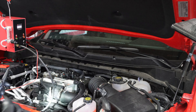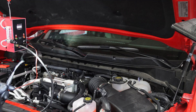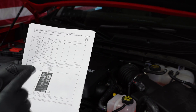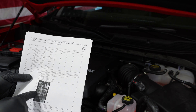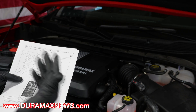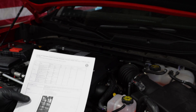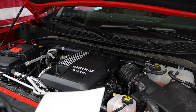We're going to be sticking this into the charge air cooler — it's going to fill it with smoke, and if we have a leak we're going to be able to see it. We've got an updated bulletin here that has now added the LZ0 to possible intake manifold issues. The LM2 had this concern as well: if there's an air leak, you do a smoke test. So we're going to do a smoke test on this LZ0 engine to show how that takes place.